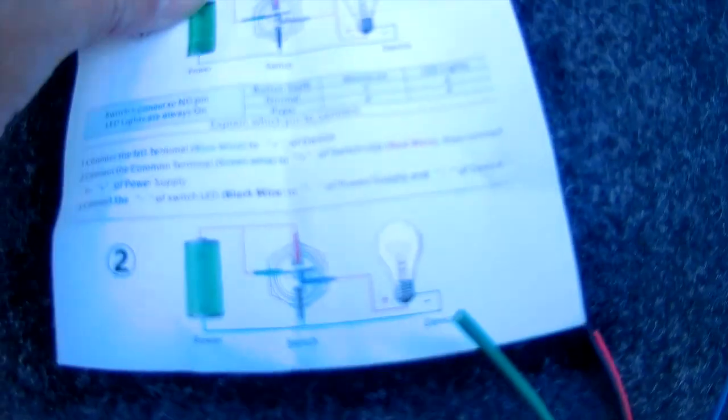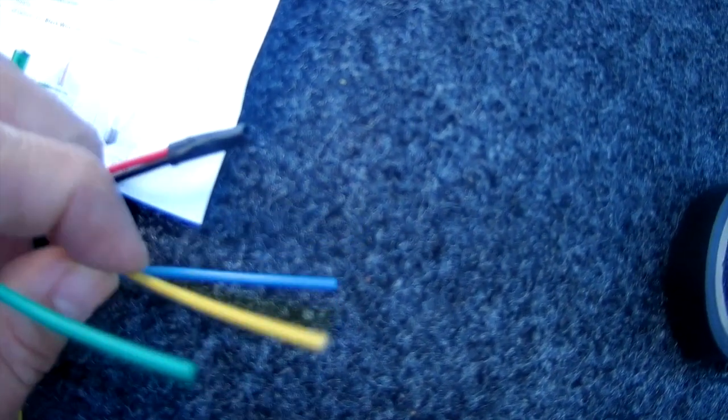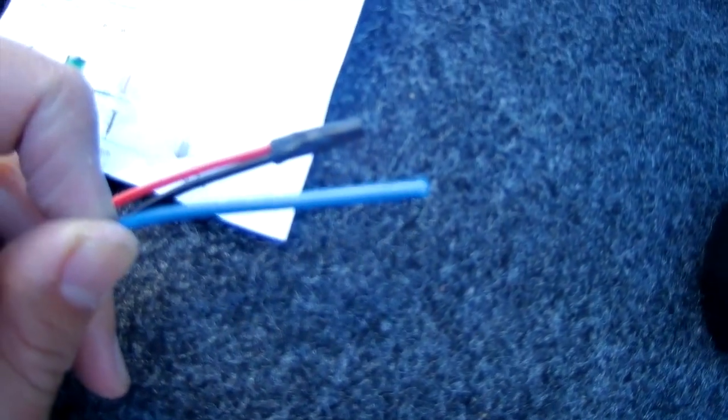Here's the switch installed. You want to remove your tail lights — just two 8mm screws right there. There are a couple ways to wire it up; I'll show a link below for the switch I got. I didn't want the LED ring on the switch to be on, so I'll show you which wires I used. You don't need the red and black wire if you don't want the switch to be lit up all the time — you basically just need two wires. Green goes to your battery, and yellow goes to your magnetic switch. You won't need the blue.